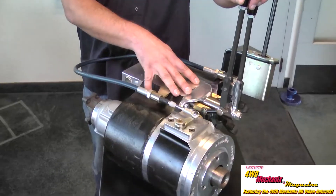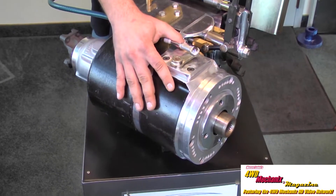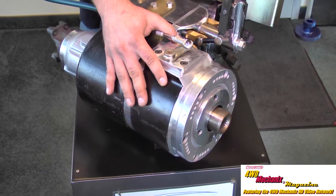For the guys that really want the Atlas but don't want to do the Rubicrawler, it's less expensive to do a four-speed Atlas than it would be to do a Rubicrawler and an Atlas. With a 2.72 reduction housing integrated into one unit, they are shifted independently of each other.